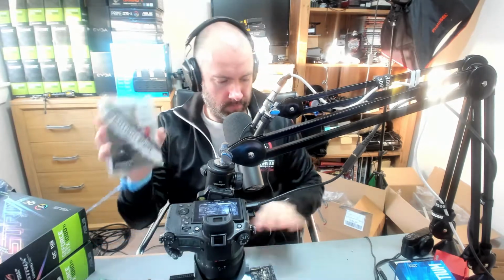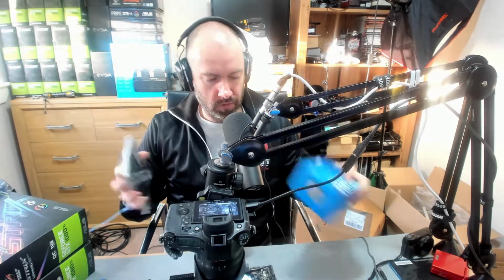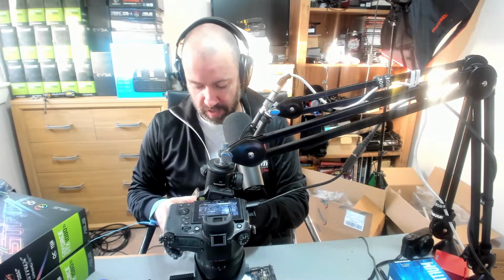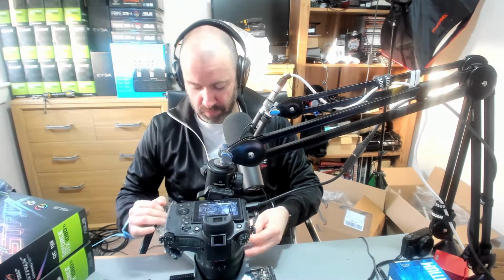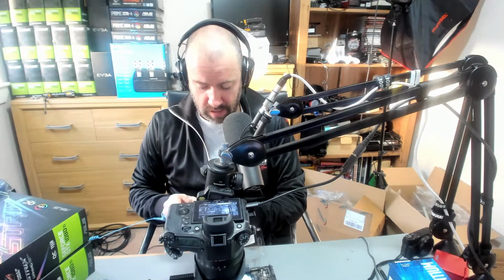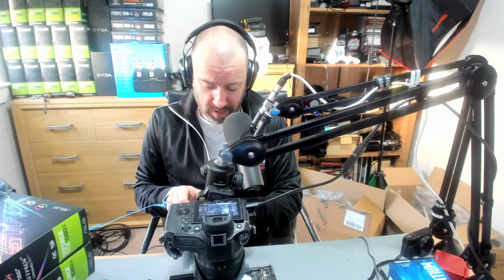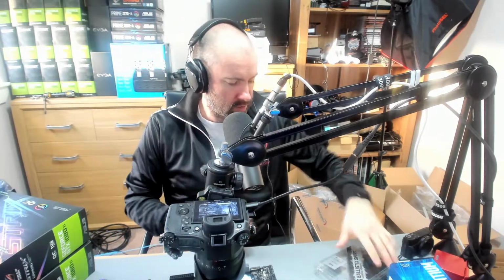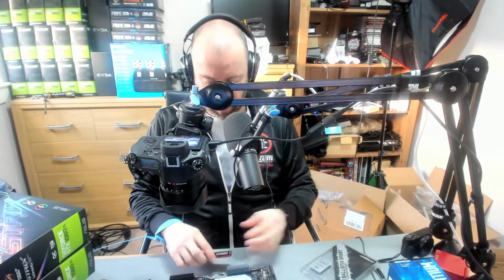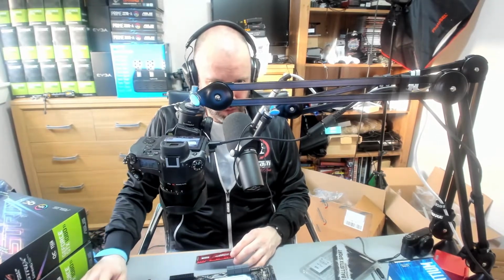So in the next part, I've got RAM, I've got the hard drive, and I've got the CPU. Now, as far as RAM goes, you don't really need much more than 4 gigabytes. Most people will recommend 4 gigabytes at most. At least. You could probably get away with less, but 4 gigabytes of DDR4. The speed I've got in this one is 2666. Apologies, the lighting's quite poor today. But 4 gigabytes is the minimum, and you could use more if you wanted to.